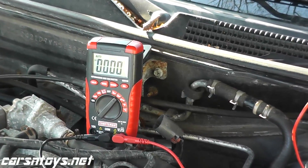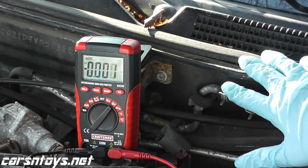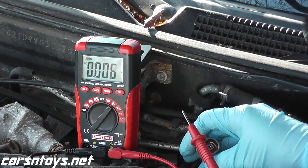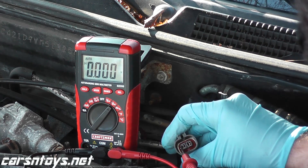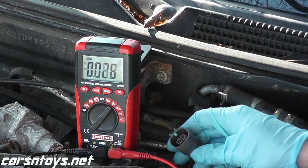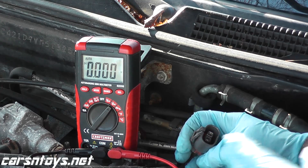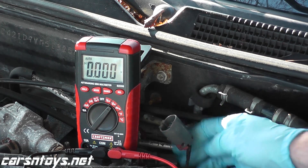If you've never used a multimeter before — the negative wire goes to ground, so any good metal point on the body, and the positive lead touches terminal number one, which is the one on the left. With the ignition key turned on, we should see roughly five volts. We have 4.8 volts, so that's plenty of power — this verifies that power is getting to the harness connector. If you have a splice in the wiring, power can't get to the temperature sensor and the sensor could be perfectly fine. So this verifies the wiring is okay.